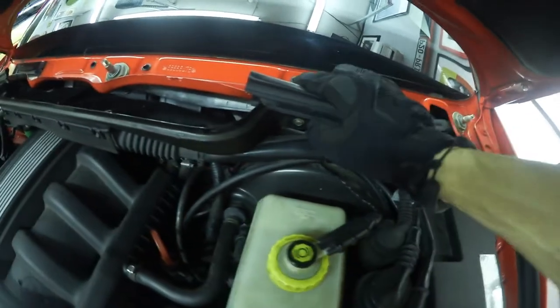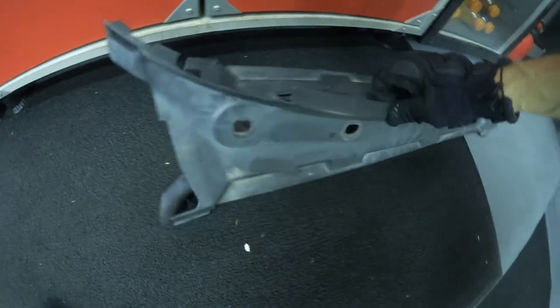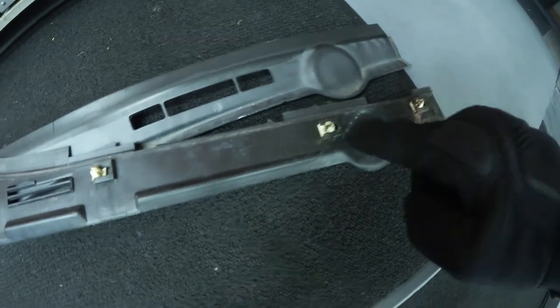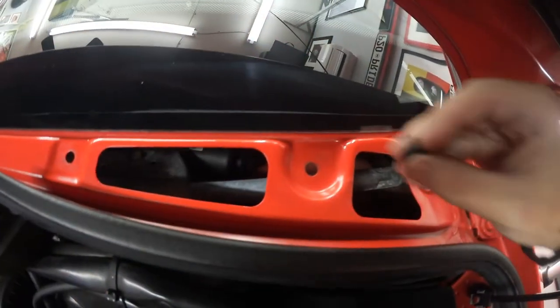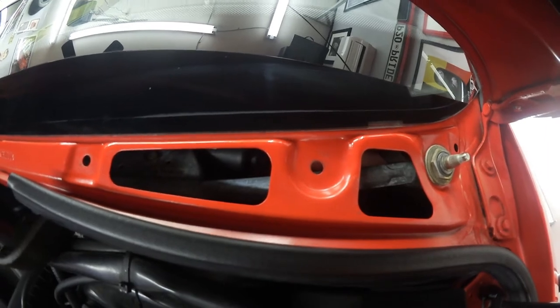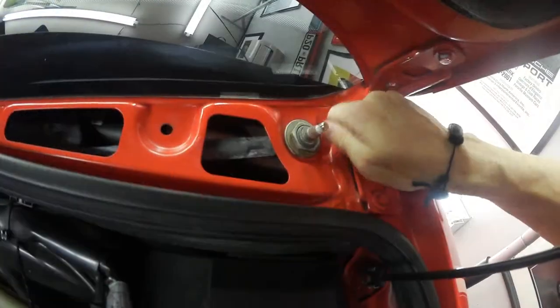As you can see, the new cowl has places here for those grommets and fasteners. Interestingly enough, that was one of the only ones that stayed behind, so I'm wondering if when I yanked the old one out, some of those fasteners came with it. It looks like a few did — you can see them right there. So we're going to be replacing all of those. I've pulled the old rubber grommets out, and as part of the kit you get replacement ones — should be one, two, three, four, five, six, seven of them. We're going to pop those back in one at a time.